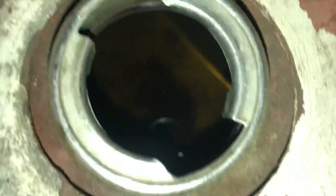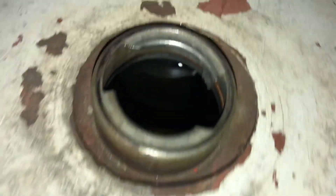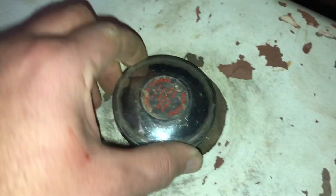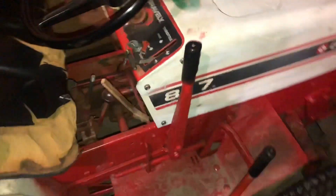I don't want to kill the battery, so I'm going to take the air cleaner off and throw a little gas in there. I better check the gas tank too. I need my flashlight — the tank has some gas in it. What the heck is that floating in there? There's like a cork float in there. It looks like it had a gas gauge at one point and the float fell off and it's sitting in the tank still — that's cool. I'll put a little bit of gas in the carb and see what happens. I put some gas in the carb and spilled it on my fingers at the same time.